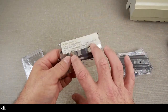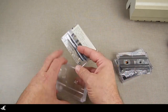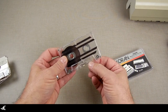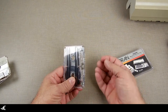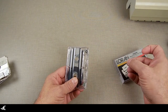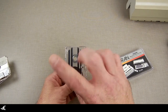All the tapes are driven by the two motors on the reels. So to modify, for my purposes, I had to drill a little hole here. To do that, I used my Dremel. What I did is I took a little piece of plastic or maybe a toothpick, pulled it out so it's out of the way, drilled my hole, made it clean, and put it back in so I don't destroy the tape.